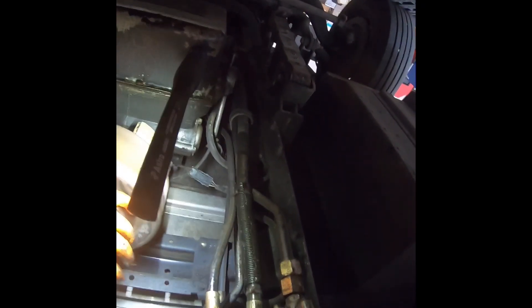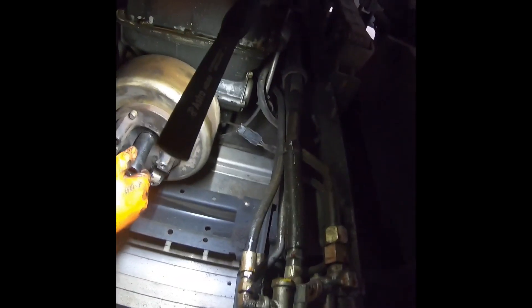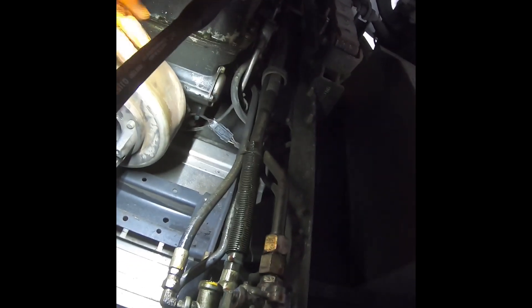The parking brake drum looks like this on the inside — nothing fancy, it's got some splines to go on the tail shaft of the transmission. Just slide it on there, feel it into place until you get it over the splines, and push it back in. Grab your big bolt, put it back in the hole, finger-thread it until you feel it really grab and you can get some turns on it. Swap out your 3/4 socket for the 13/16ths. You can hear the sound change with the impact — just give it a couple of good snugs, nothing crazy.